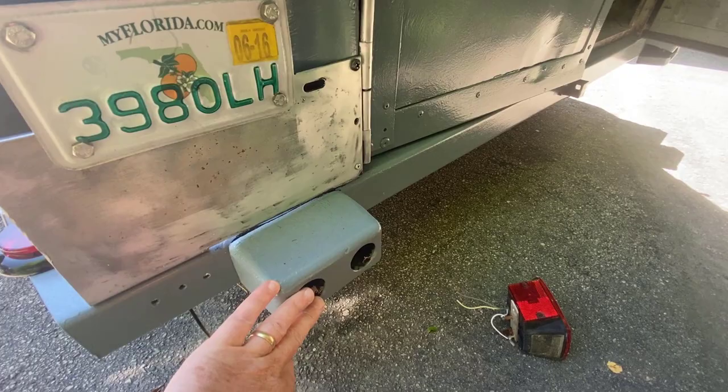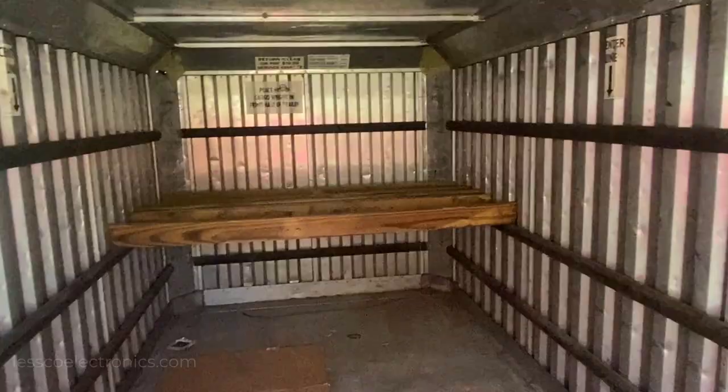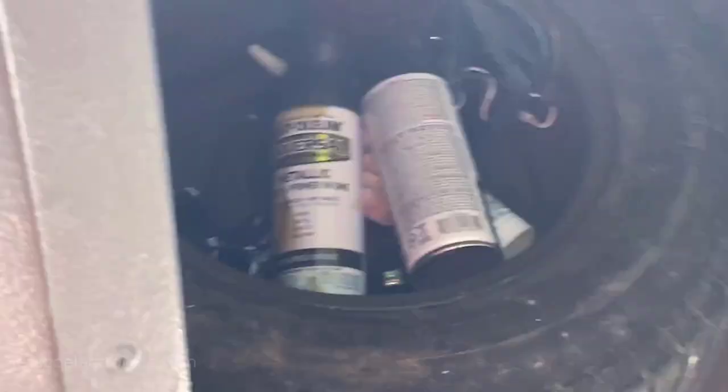I got some new stainless hardware which I'll be using everywhere. On the inside I cleaned up this mess and ran some wires through the single positive lead. I'm going to use some flashing tape, run those straight up with wire loom, connect them together and back down at the parking light wire which runs through the bottom of the trailer. I'll use wire loom, zip it all up nice and neat, waterproof it, tape it so it doesn't drag on the ground.